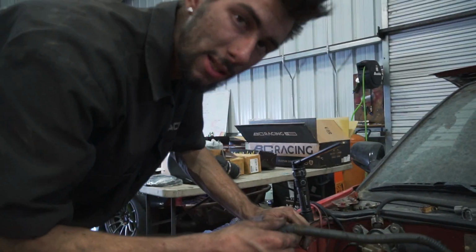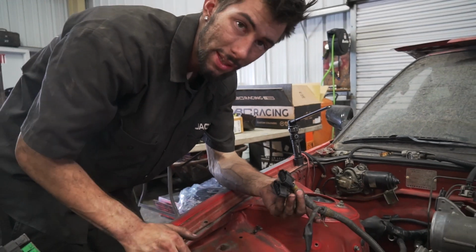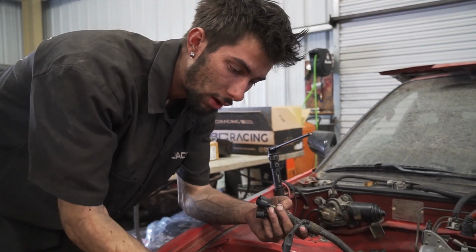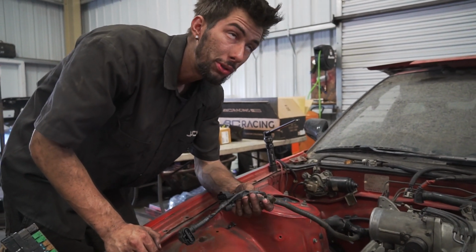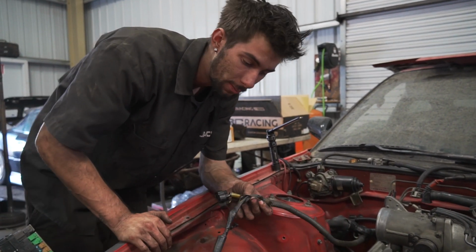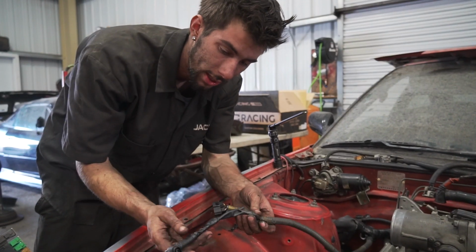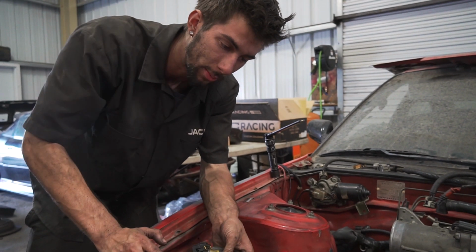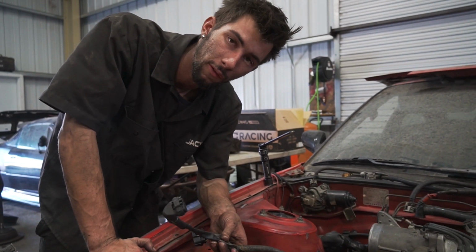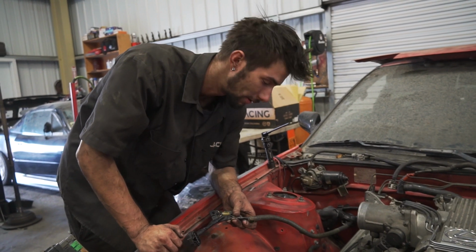So here is a little bit of unnecessary work, but it's kind of the TTP taste. These two clips on your harness are going to be the igniter chips for both 1 and 2 on the heads. This is going to be your MAP sensor. That being said, I want to try and eliminate how dirty it is in the engine bay. So I'll be splitting the loom, putting the igniter chips inside the car, nice and tucked away, having the MAP wiring just by itself. So I'll be able to plug that and the motor will still be able to function properly. Let's get started to see what Terry has on his list to show you guys.